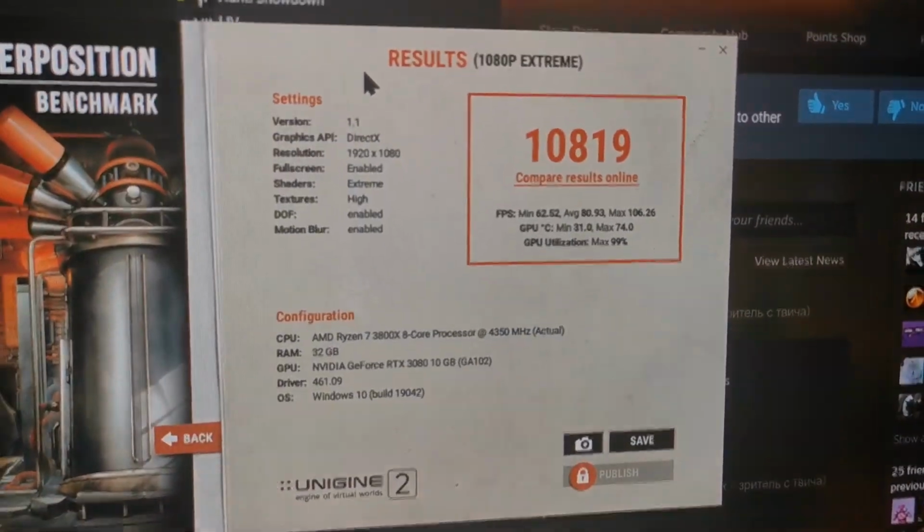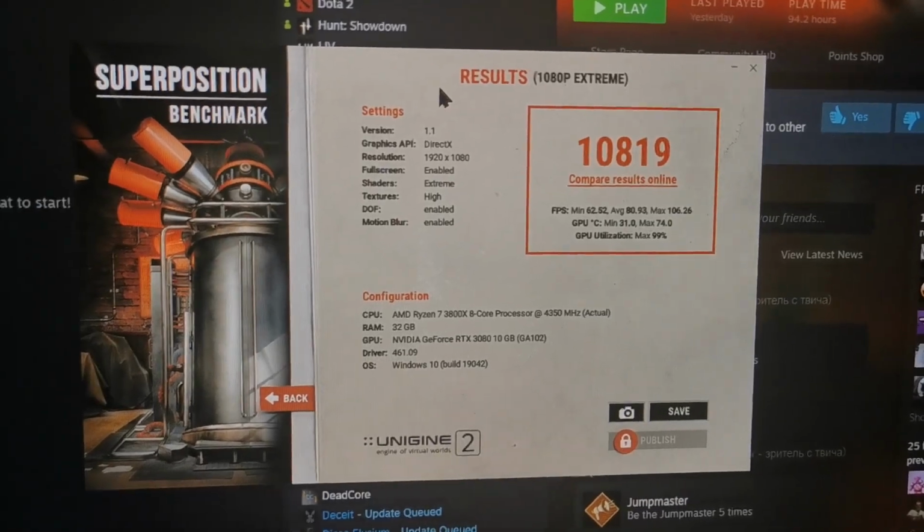And after a lot of stress, this video card is working. It's cooled with this Bykski radiator with integrated pump. The pump is actually really noisy. And I replaced the fans with Noctua fans, 120mm each, and this is what I have at stock settings in the Superposition benchmark on the water-cooled video card. I didn't optimize fan curves yet, I'm going to do this soon.